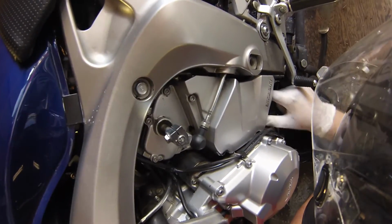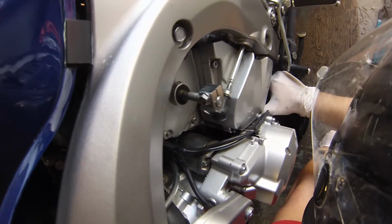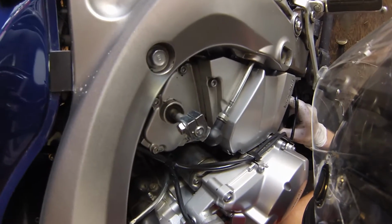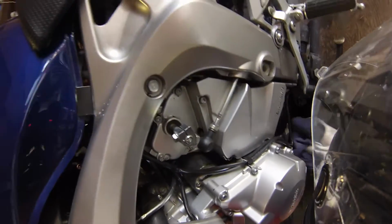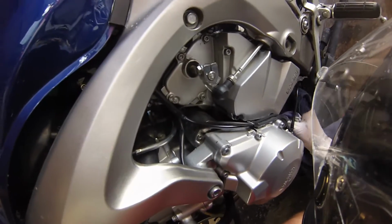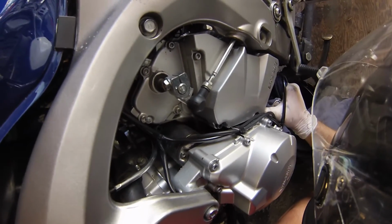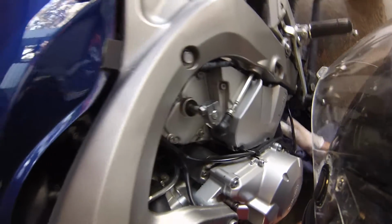And then, like I said before, these things should only be hand tightened. I mean, as tight as you can get it by hand, but that's it, so you don't end up experiencing the horrendous thing that I did. Because I was starting to panic, especially after I crunched the filter. I was like, oh, well, now I can't run the bike. Get it with a rag so you can get some better grip on it. And it turned maybe another couple 1/8 of inches or something like that.